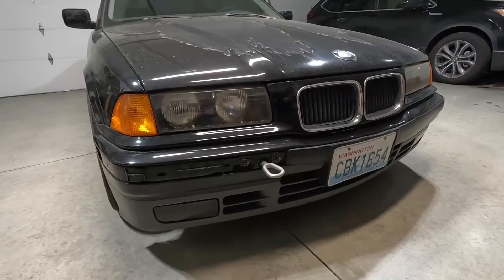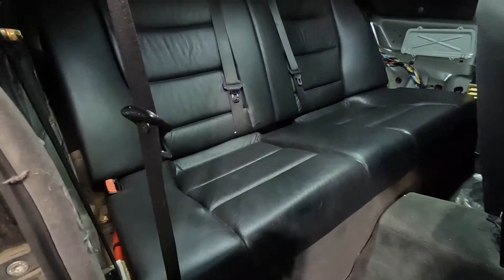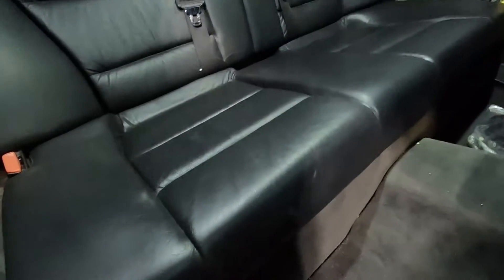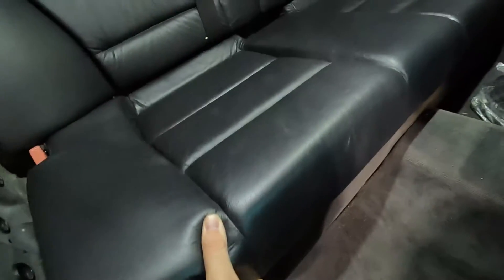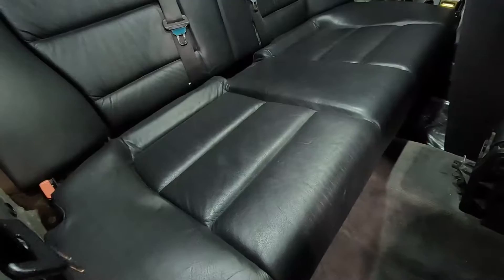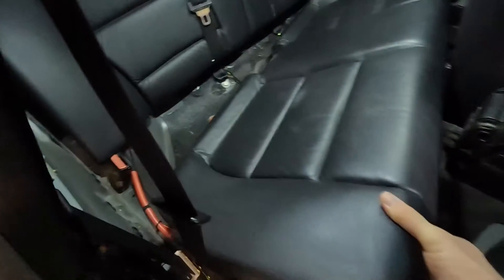Last thing to do is get the rear seat out. This is a little DIY on how to remove the rear seat in the E36. I don't have my side panels on here, but this is just to remove the back seat and it's really easy. First, grab the bottom of the seat and just lift up — it just pops up. Do that on both sides and the whole thing pops up, then you pull it out. Once both sides are popped up and pulled out, the whole bottom pad is loose and you can take it out.